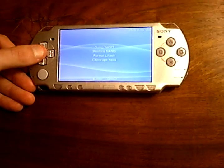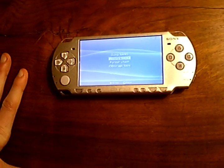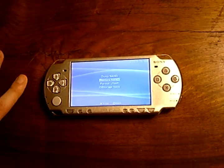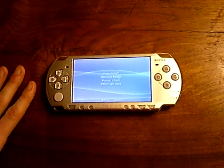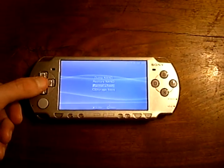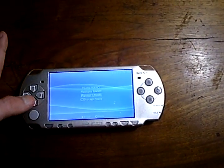The second option is restore NAND, which takes a NAND backup and writes it back to the PSP. NAND backups are per PSP — do not swap them between PSPs. It is solely for backup; in case you screw up the PSP with modding later and brick it, you can boot off a Pandora battery and restore the NAND. There's also the option to format L flash, which will format the PSP — this has very few uses and you will not be using it.